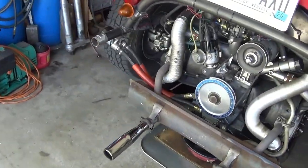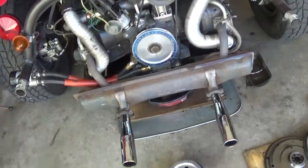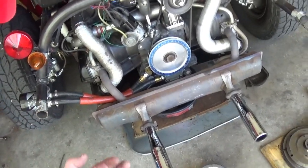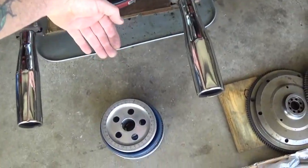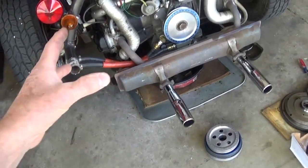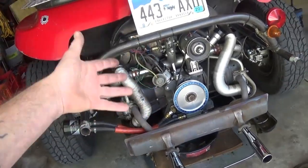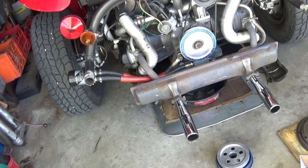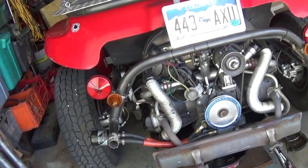Exhaust systems are one of the most available aftermarket parts, but it won't help this system. This exhaust is not restrictive — it's ugly, it wasn't meant to be shown, it sits up underneath compact and out of sight. We haven't made any internal changes — this isn't a stroker, it's not high compression with a cam, it's a worn-out stock engine. If what you're after is a new sound, do whatever you want, but your car's not going to run as well and your gas mileage is going to go down.